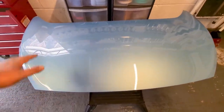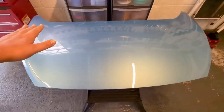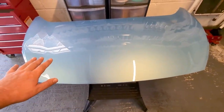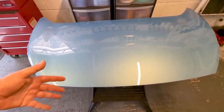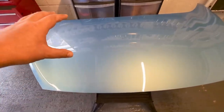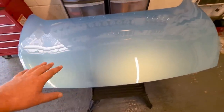Now, when you polish a car, it's a bit like laying a wax out on the car. The polish is full of kind of carrier materials in it, and you spread it all over there, and it's getting a bit of heat in there as you're working it. And the carrier, which can be solvent-based or water-based or an emulsion or bits of both, gets hot, some of it vaporizes. But essentially, you're leaving behind polish on the panel, even after you've wiped it.